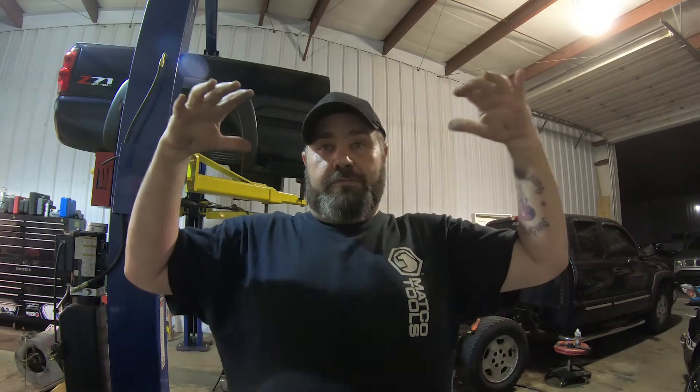In this episode - episode three - we're going to concentrate on the bed. We have four broken bolts in the bed; there's a total of eight bolts that hold the bed to the frame. The problem we're running into is that two of the further rear bolts have nutserts that are actually spinning inside the bed rail, and the reason they're doing that is because the bed rails on this thing are pretty rotted. We do have six really good bolts - two that are stuck but I know I can get out, and four that are perfectly fine. So we're going to concentrate on getting those six bolts in, because this truck is not used for heavy hauling, so missing two bolts is not a bad thing.